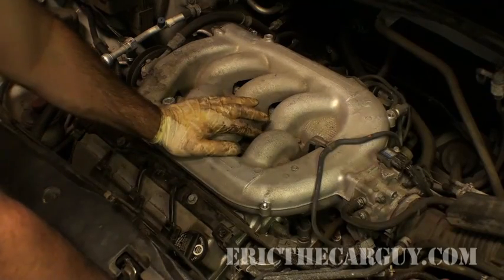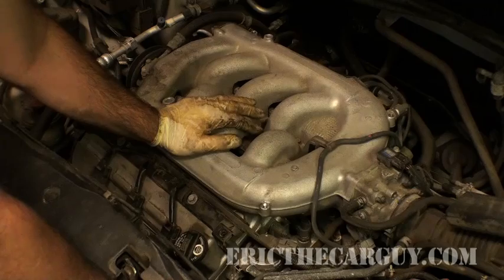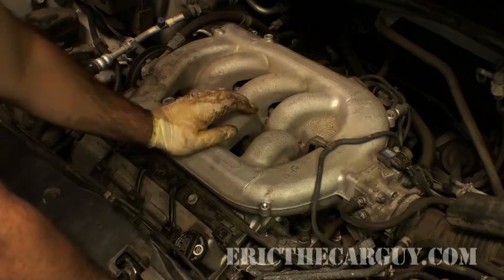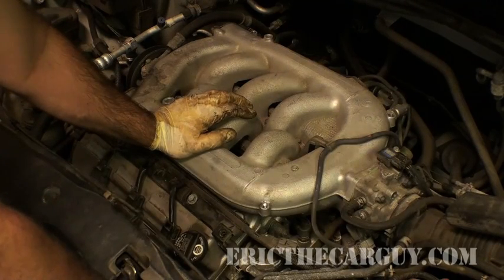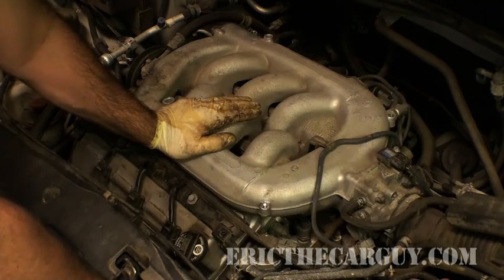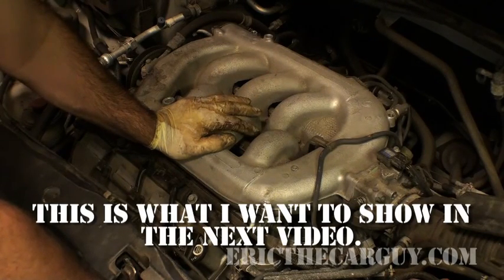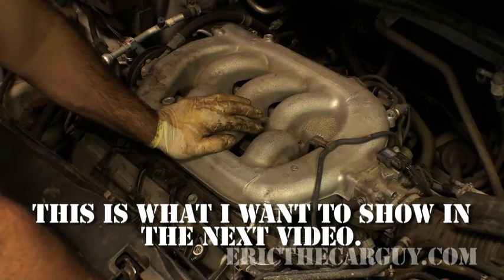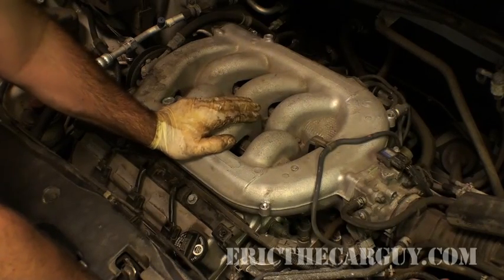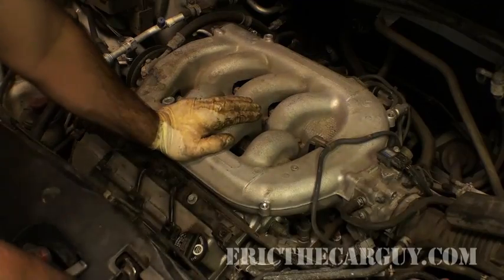If you've got a set of coil packs or something, you don't necessarily have to do this at the spark plug if you don't have access. You can just as easily perform this test at the coil packs themselves. I could show you a little trick with little pieces of vacuum line that you can place in place of the spark plug leads on the coil packs, and you can take a test light and poke it against the vacuum line — creating a space between the coil pack and the wire — and cancel out the cylinder safely and effectively. But we're just going to show you how to unplug coil packs right now.